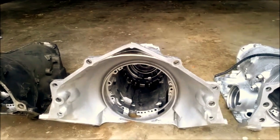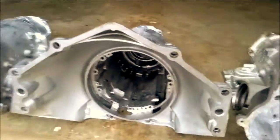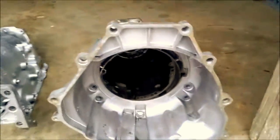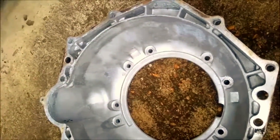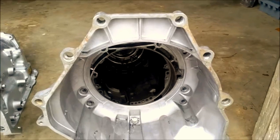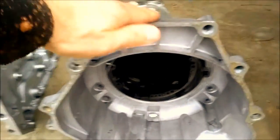From 91 to 93 they started using these V8 bell housings, and then from 96 to 97 they started using these, which is a bolt-on bell two-piece case. The bolt-on bell two-piece case also came in a version for the V6s - because again the 4.3 V6 used the same as a V8 - but the smaller V6s, the 2.8s and similar, and the 2.2 liter 4 cylinder would use this right here, which is another version of the flat top.